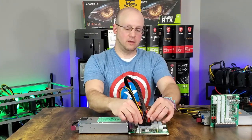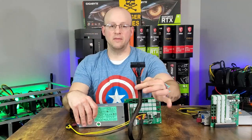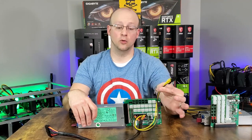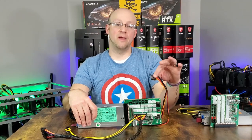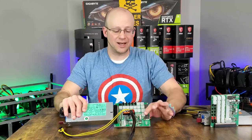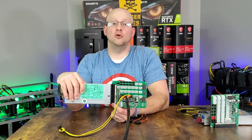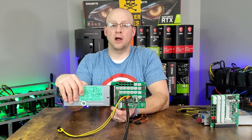24-pin — click — with nice even pressure. Here is the 24-pin that runs to your motherboard to supply power, and here is your 4x4 CPU power that plugs into the motherboard to power your processor. The next thing to hook up is your Molex to Molex and SATA adapter, used to power your hard drive or solid state drive. Make sure to slot it into the slot labeled SATA and not the slot labeled remote — plugging your Molex into the remote section can back-feed and cause irreversible damage to the breakout board, server power supply, or other components.